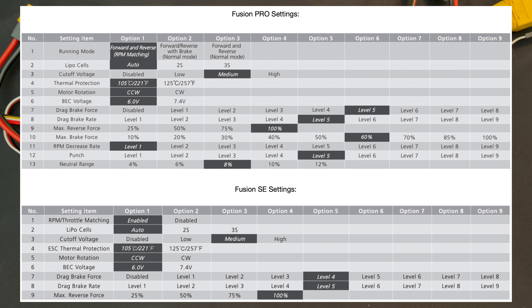Setting 10 is the max brake force — that's how strong the push brake is, not the drag brake. If you run it in forward/reverse with brake mode, you get a push brake instead of auto brake, and this lets you control that strength. Setting 11, the RPM decrease rate, is how the FOC responds — level nine is faster, level one is slower, allowing you to tune that FOC feel when driving like a rock crawler. Setting 12, the punch, is more for basher driving where you don't want the throttle to respond immediately. For rock crawling with fine inputs, leave punch at level nine for a nice linear throttle.